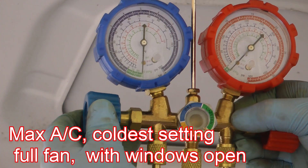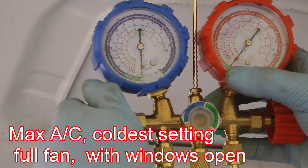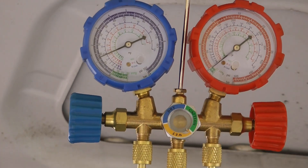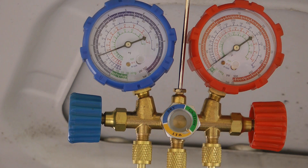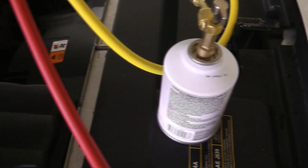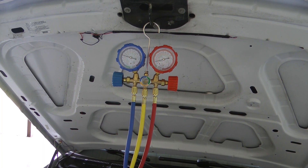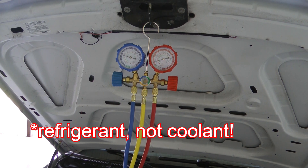Running the car with the air conditioner on. We're gonna open up this valve — only this valve — making sure that the high pressure is closed. The refrigerant should run through there and get sucked in. You can watch for the compressor to kick on and off. It's typically not gonna run when it's low pressure, but every now and then it'll kick on and eventually suck up the refrigerant until it gets enough that it'll stay on. If you want, you can bypass the AC compressor relay to make it suck up the refrigerant faster if you're in a hurry.